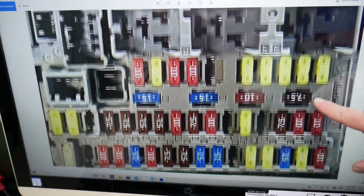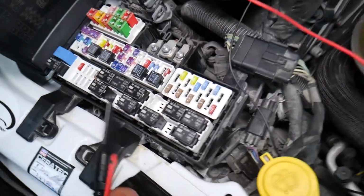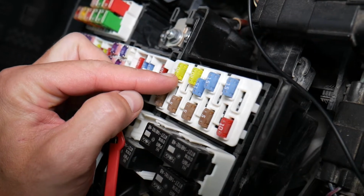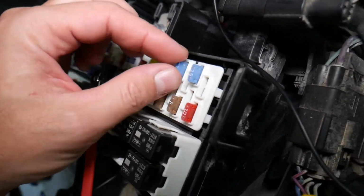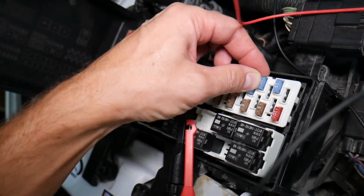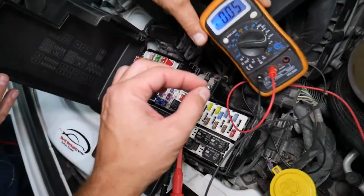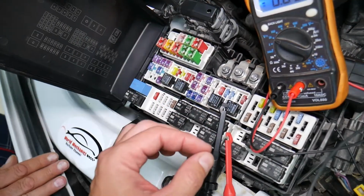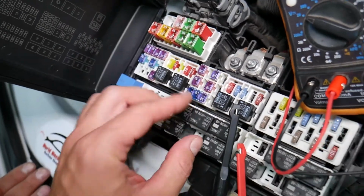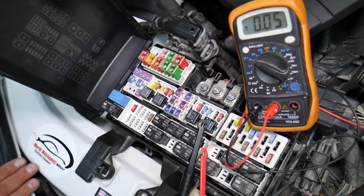But before we continue, let's explain why it's important to test fuses and relays. Let me explain why it's super important to test fuses. Often you can't see if they're burnt or they're good. Sometimes they may seem perfectly fine, you think it's a good fuse, you put it back in and you end up spending money and time on parts and problems that do not exist, when all you had to do was test your fuse, find out it's bad, replace it, fix your problem. So we will have a video on how to test a fuse, different kinds of fuses, and how to test relays. We're going to put the link in the description of the video below specifically to that video.